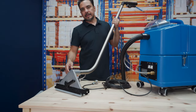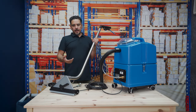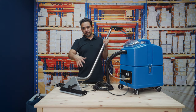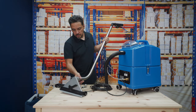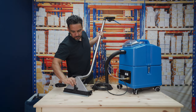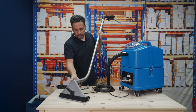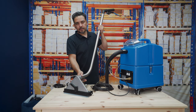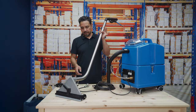If you want to clean tiles, vinyl, or hard floors — say there's an accident on tile floors at a childcare centre — you just move the lever down. The squeegees will drop, and now you can go ahead and suck up and extract liquids off tiles. The vacuum in this is sensational — it'll leave the floor completely dry.